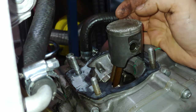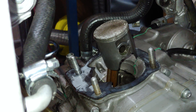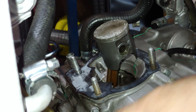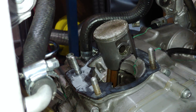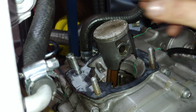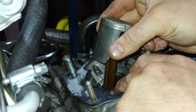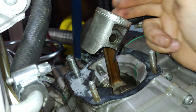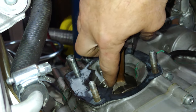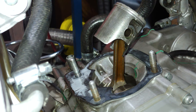How did that happen - I guess it makes sense if it shot up through the transfer ports. So I'm still kind of in four-stroke mode thinking for my 250. It looks like a new bottom end is what we're looking at, and to me that's cheaper than getting another one of these cylinders. So I'm about to get a new piston and a new crank. Look at that - it's spinning the actual bearing. Luke told me to keep an eye on that crank too - so she's coming apart, and that's it folks. Unbelievable.